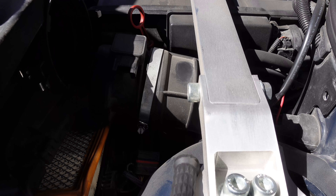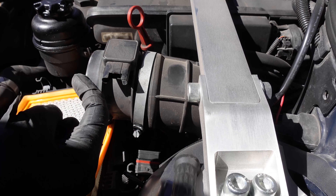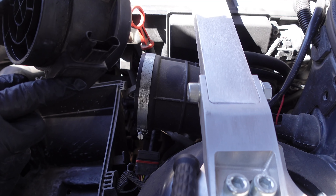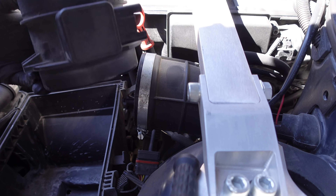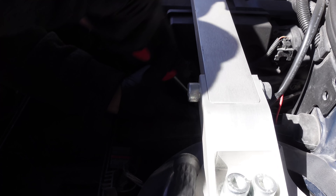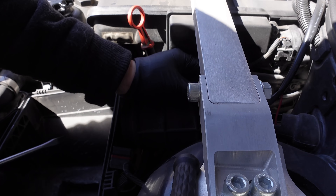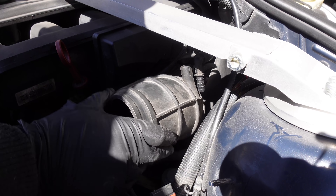Everyone always wants you to remove the snorkel over there. I don't understand why you would remove the snorkel — you can just pull the airbox out of it. How did I already tear my glove? Mass airflow sensor looks good, which is good because the 330i uses a special mass airflow sensor. They're very expensive. Don't want to have to replace that. Pull what's called the F connector out — the F connector is putting up a fight. Fortunately, I don't care if I damage the boot since I'm already replacing the boot, so I'm just going to go at it with a flathead screwdriver. This just split apart with next to no effort. This rubber is done.